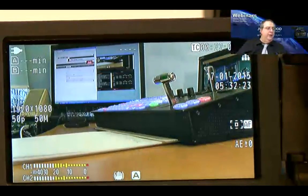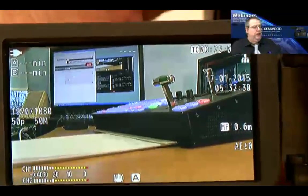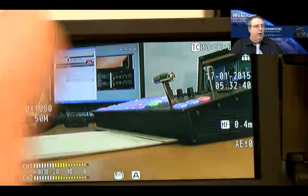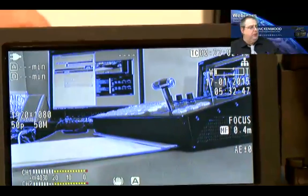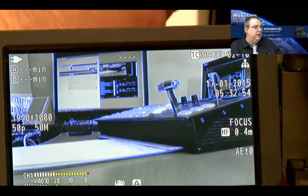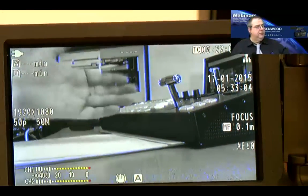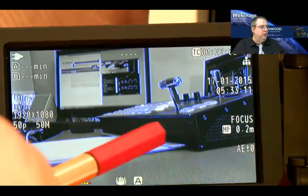Well, furthermore, if you have high resolution and you want to do manual focus, let me switch the camcorder here to the manual operation of the iris. So now you can see I can change my iris level, but you want to have better focusing. Well, you can use the normal focus assist feature, and when you switch that on, you get these typical black and white pictures, and everywhere we are in sharp focus, you get blue lines. So for example, you can see here the back line when I focus on this one, so then I'm in focus on this level. Yeah, so that is my selection. My distance here is not so far, so I have not so much option to show that in detail, but I think it's clearly visible when I'm in focus or not.